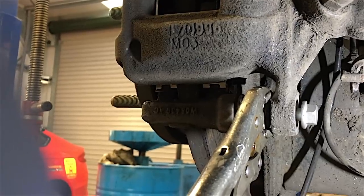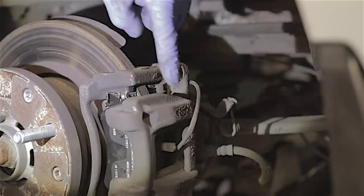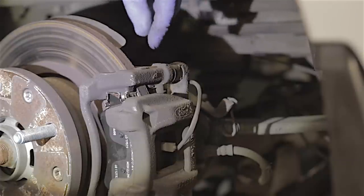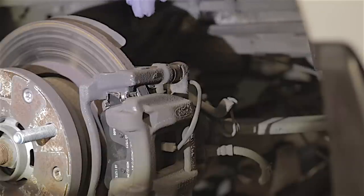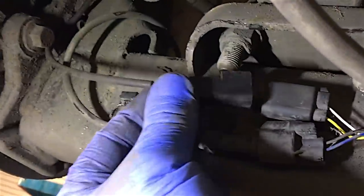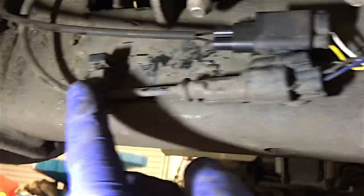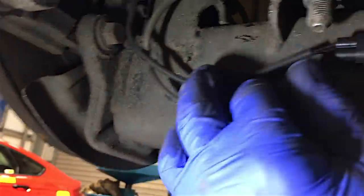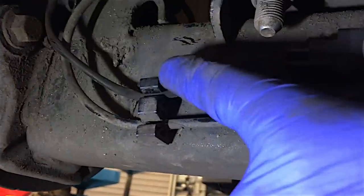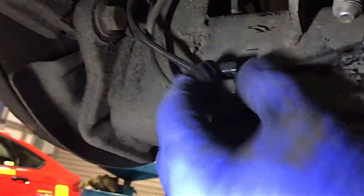Get my mole grips on that and I'll tighten these two bolts up. The brake pad sensing wire — I've fed that back through next to the bleed nipple and put the cap on so that wire's secure, and I've routed it back the way it originally was. I'm just going to connect it up on the back axle now. We'll plug that back in — make sure it's fully home. There's a little clip here that the wire's supposed to go into, so you just push the wire into there. That'll hold it secure. Normally you have to get a screwdriver and prise this clip open to pull the old wire out — but the old wire you're not going to use anyway. So that's it — job done.